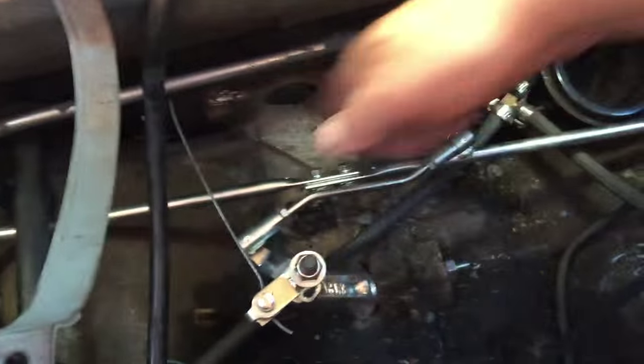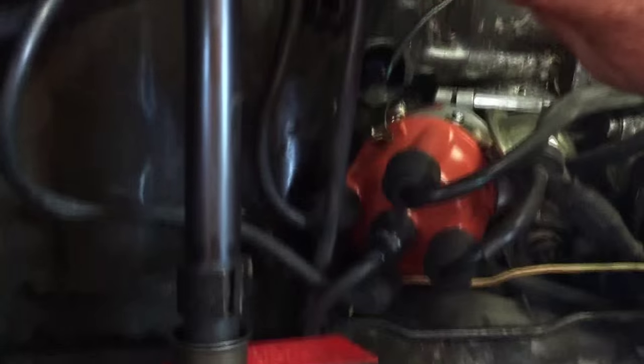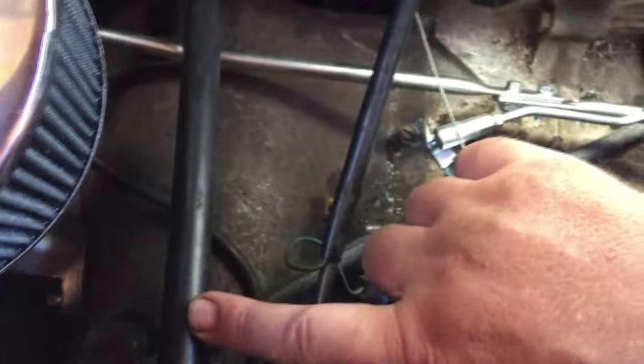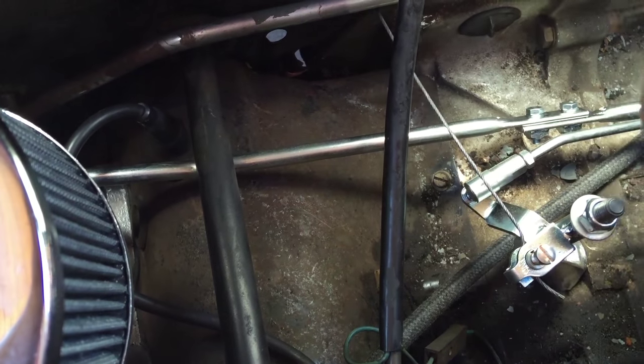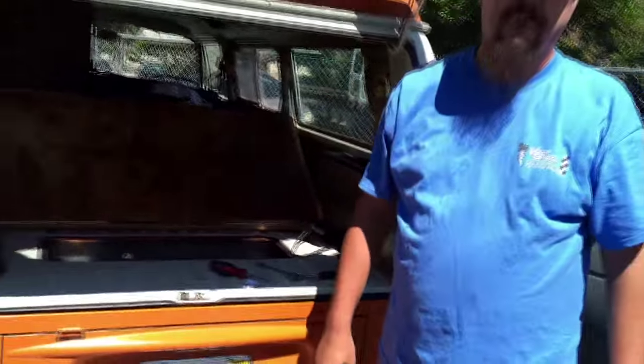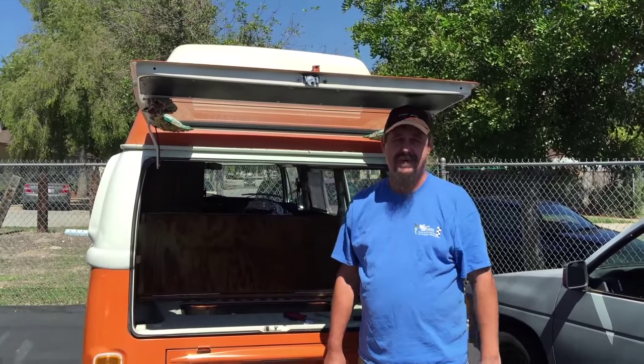The linkage crossbar goes here — it's a normal crossbar. The Type 4 automatic has a dipstick tube for the transmission to check your transmission oil, and that tube is going to be in the way of the linkage. So just put a little bend in that linkage right there and have it go under that little tube — it's not too hard. Make sure that as you cycle the linkage it doesn't hit that bar. Boom, done. That's it for our Type 4 Tech TV tips and tricks. Go to it — get that thing running!